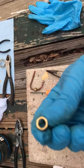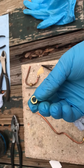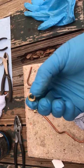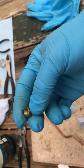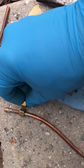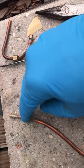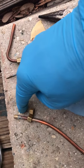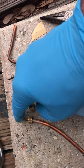What I realized was the original nut I had made was a little skimpy on the backside. When I cut it off, there's just not a lot of shoulder between the threaded portion and the rear portion. So I realized when I connected it, I may as well redo it now. I made another nut that's a little bit deeper with a little bit more metal on the backside — a little more shoulder — and I unsoldered this fitting, took the old nut off, put the new nut on, and re-soldered it.